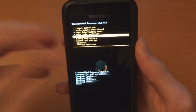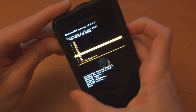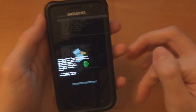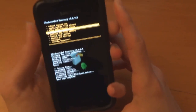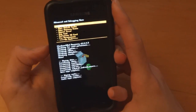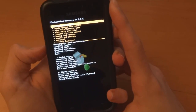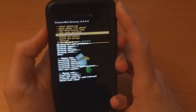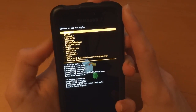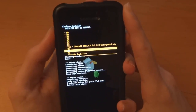So if you need a wipe, you can go to wipe data factory reset, which I'll do anyway. Once that's done, wipe the cache. Dalvik is not very much needed but you can try that too. Then we can go install zip from SD card, choose zip from SD card, and there you should see the ROM — CNA — and install.